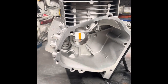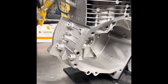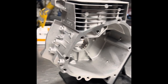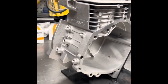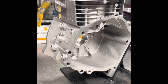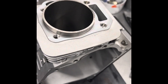Here's another block — this is a 3.108. You can get these on the website unwelded, under the same listing as the 2.990 or 3.004. You just add a $75 tooling fee to change the tooling and go to this bore size, and you can get the piston right under the same listing. This right here is the new 3-inch block to me — I wouldn't even recommend anybody get a 3-inch block anymore. It would be a 3.108 or bigger, because as you can see, there is plenty of sleeve thickness in these.